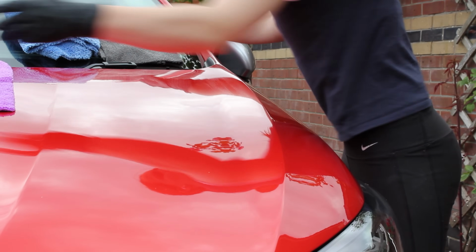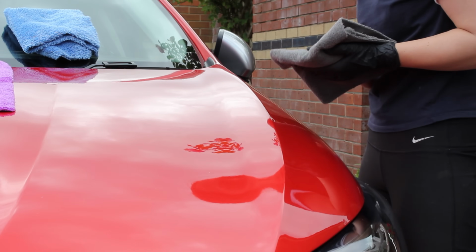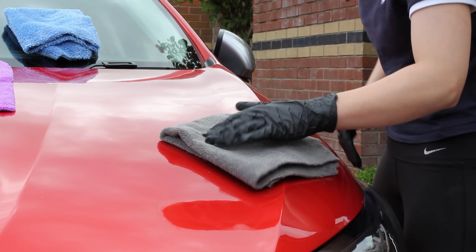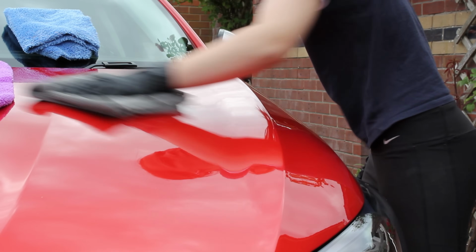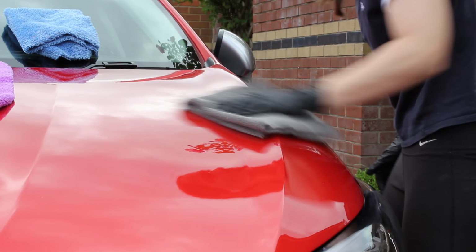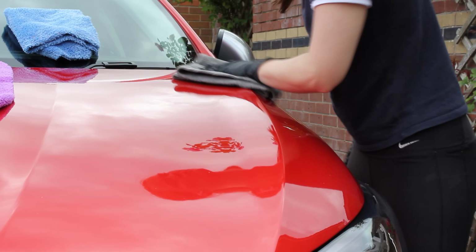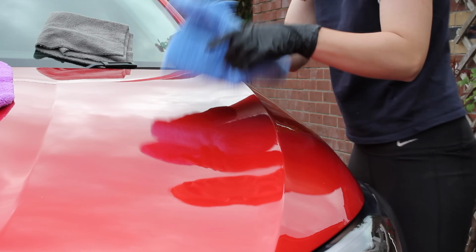So when you spread it, I would recommend doing it in a fairly small area, so sticking between shoulders width and not really reaching across the car, because with this coating, the time between actually applying it on the panel and wiping it off with your microfiber towel is actually pretty short. I was noticing this happening at around the 10 to 15 second mark for me.